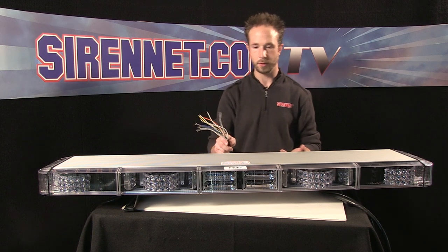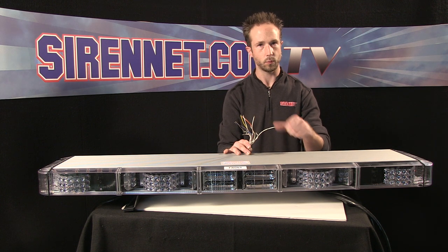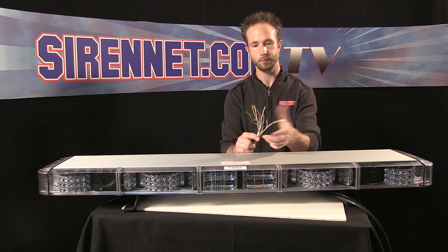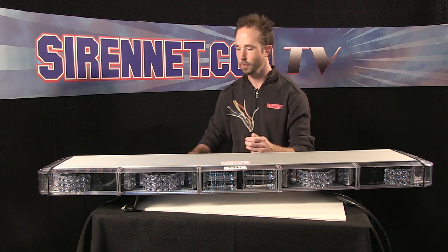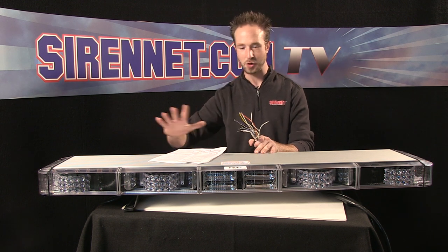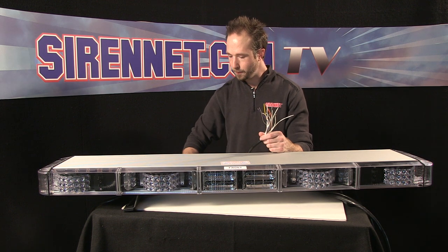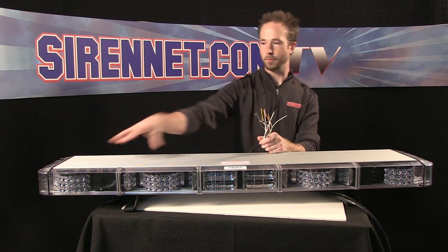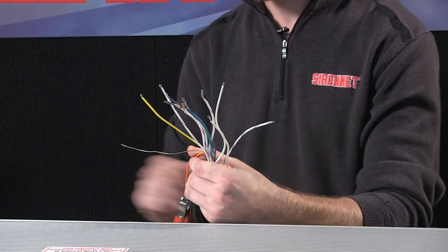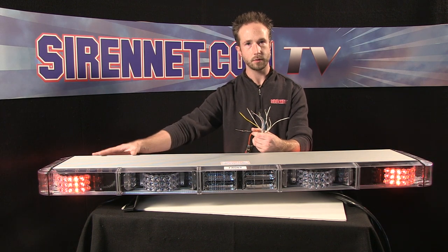When you get to this point in your install in your vehicle, you can use each wire independently, or if you want to tie them all together for one button or one slide switch, you can light the whole thing up by tying the wires together to put all the functions on at one time. With a little assistance from the trusty install guide — I just don't have all these nice colors memorized yet — the first thing I'll show you is the cruise light function. We'll light up the corners alone as a soft glow, giving you that classic cruise light mode.